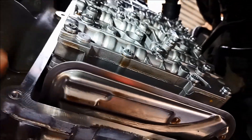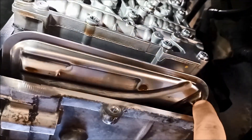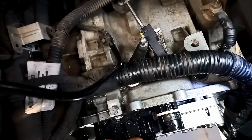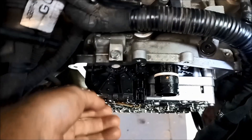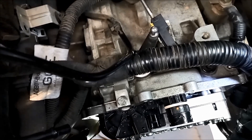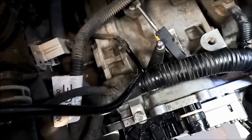All torqued up. Don't forget to put your magnets in — adding additional magnets is very beneficial to these transmissions. Don't forget to push the range sensor plug back in; you've got to weave it through first, then push that plug in.